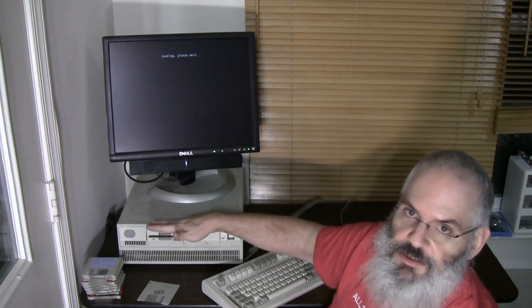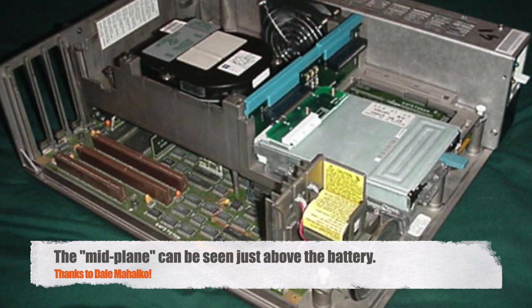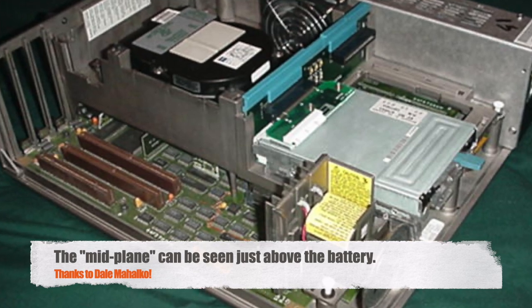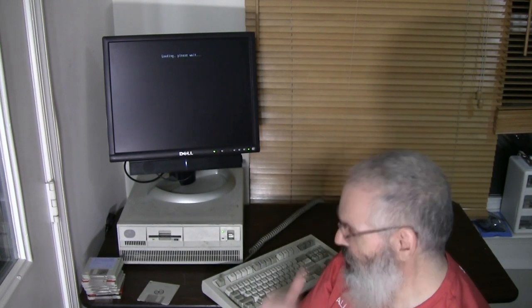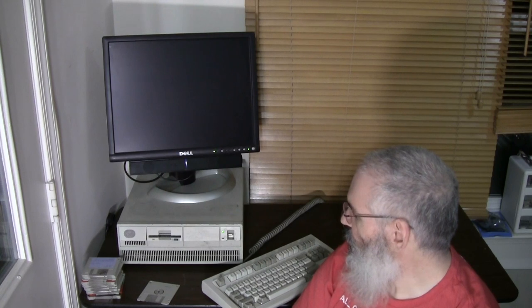The plastic, in comparison to a lot of vintage hardware, has actually stood up pretty well — which is fairly impressive. There's a midplane inside this case about halfway up, attached to the bottom of the case with plastic rivets. There's a little tool that sits right here on the motherboard, and that tool will pop up those plastic rivets because they are meant to be reused. It's a little alarming the first time because they make quite a snapping noise when you pull them out — you think you broke it, but that's the way it's supposed to work. PS/2s are pretty nice to work on.